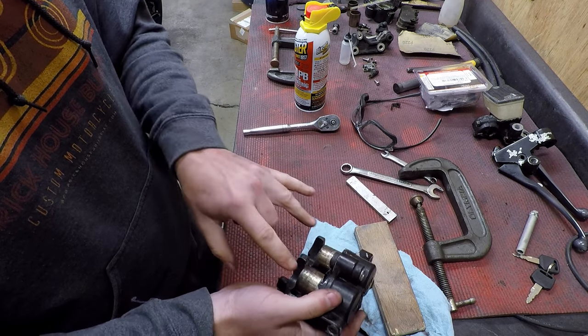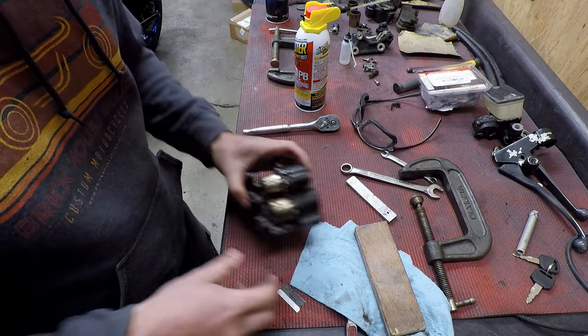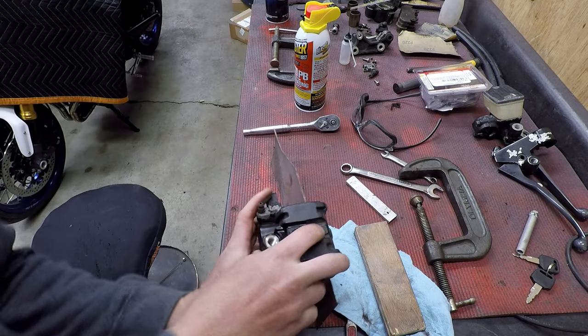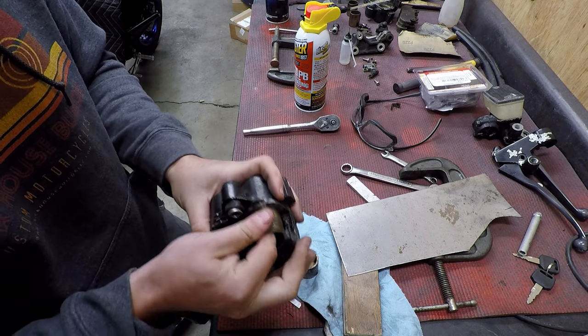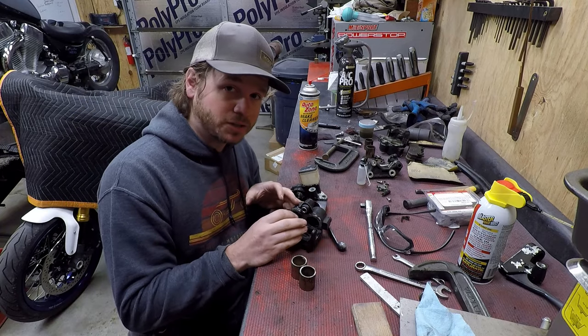Now the tricky part — thinner yet. Once one of them comes out, you're going to obviously lose pressure, and then you're not going to be able to force the other one out. So just keep working at it — this is when it gets a little tricky. Just got a piece of sheet metal here. These things are almost all the way out. There we go. These things actually came out a lot easier than I was expecting. There's definitely a lot of corrosion in here, and basically it's the outer dust seal that really just gets hung up on these things. The pistons have a bunch of gunk on them, but they're not pitted or corroded — it's just from the breakdown of the brake fluid over the years.